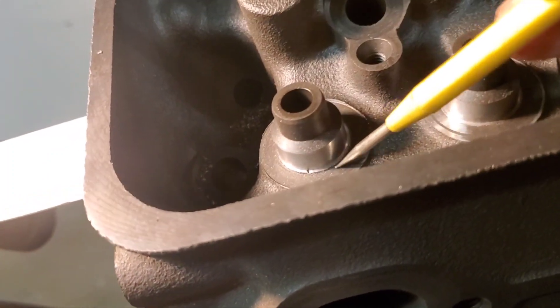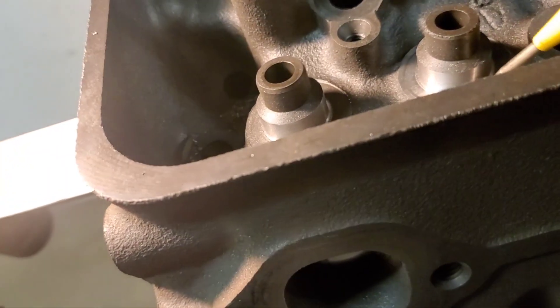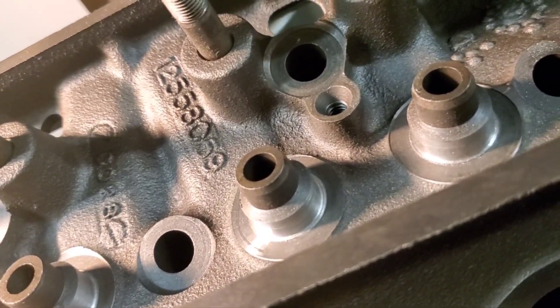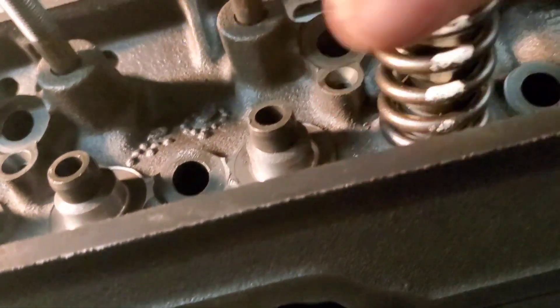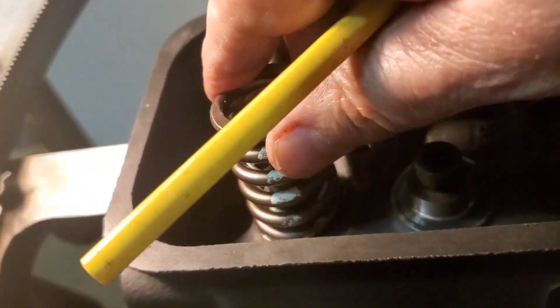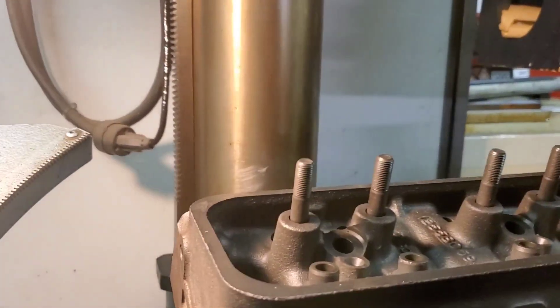You can see there — I'm just taking my stylus and coming in there. There's just a little tiny step, and that'll be where that dampener sits, but that'll be okay. Looks real good. We can put a standard small block Chevrolet valve shim on there and we'll be good to go for setting our spring heights.